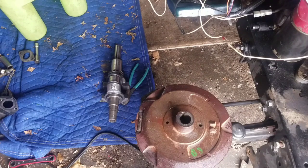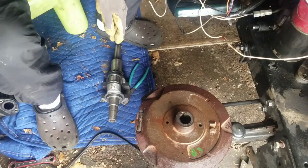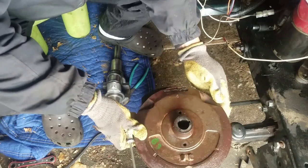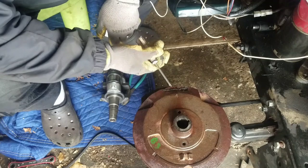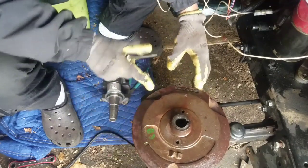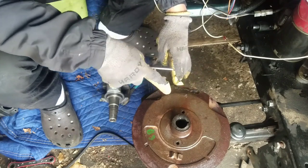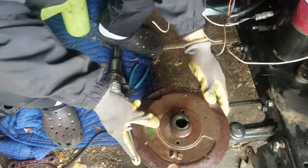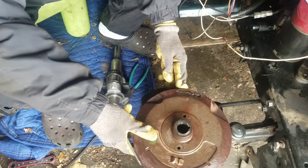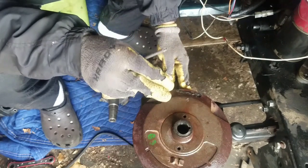I wanted to show you guys my spare flywheel as well as my spare crankshaft. So this is pretty interesting, okay? As you guys saw, I basically lined up my magnet to my magneto right over here. And I lined it up so that the magnet was here, and this part of the magnet was touching the trailing edge of this part. So it moves clockwise, right? And the flywheel spins past the magneto right around here when the piston is at top dead center with the dots matched up between the crankshaft and the camshaft.